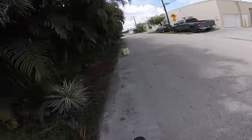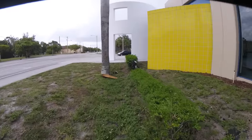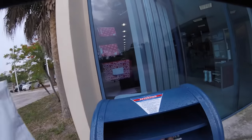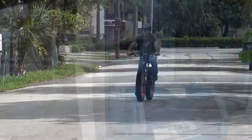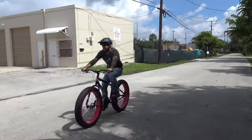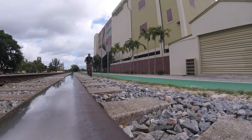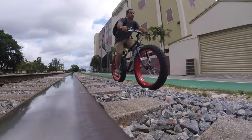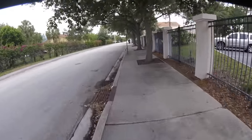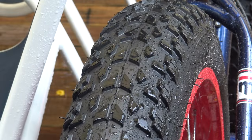I have ridden quite a few fat tire bikes, and they were generally heavy and sluggish compared to their skinny counterparts. Still, I was always pleasantly surprised at how well they handled for their size. Not this bike. If you pump the tires to 20 psi it rolls and steers well, but it's then useless on sand or chattery terrain. Reduce the pressure to 10 psi, like a real fat bike, and its off-road performance does improve. Unfortunately, this makes the bike extremely difficult to control, as the steering pulls whichever way you're turning. I think this is due to the cheap tires, which are pretty thick and shaped oddly.